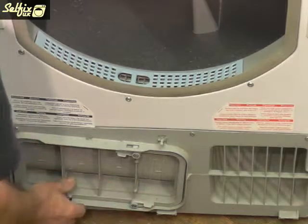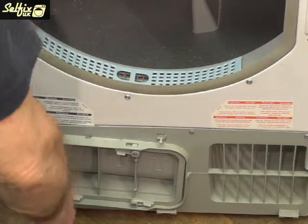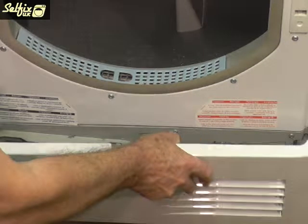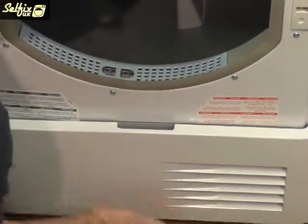Put the condensing filter back and lock it in place, then reattach the lower flap. If you put it on as though it were closed, then just tap along the lower edge, it will fit back easily.